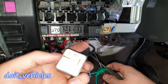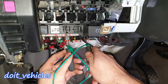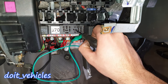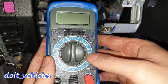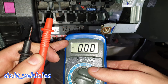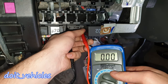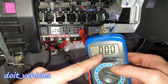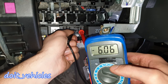Pin 87 and pin 30 are the thicker pins on top. I've got an improvised jumper cable with 2 hooks, and I'm going to jump those pins — pretending that the relay is open, activated by the ignition switch relay. I can hear the pump running. Now if you take your voltmeter, set it to 10 amps and reverse the terminals, you've got a jumper cable with a gauge that reads how much current passes through. Connecting the terminals on those 2 pins should activate the pump — it should be around 5 to 6 amps.